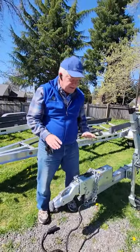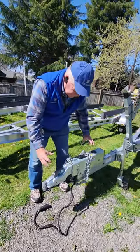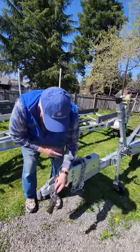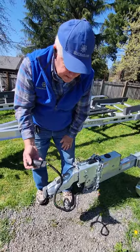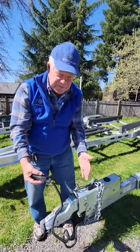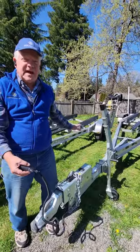When you go to back up, the same thing happens. On flat ground it probably won't do it, but if you hit a bump or you start backing uphill, this will compress again. So this blue wire — the fifth pin of the flat 5 — if it gets 12 volts from your backup light circuit, will prevent that. If that's not working because your fuse is out or because your ground is poor, your brakes will get set.